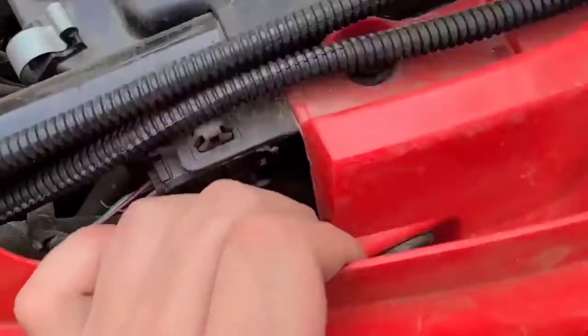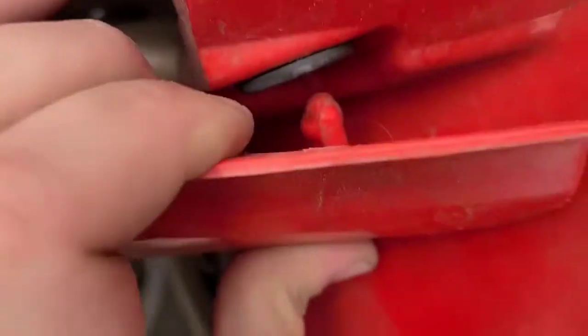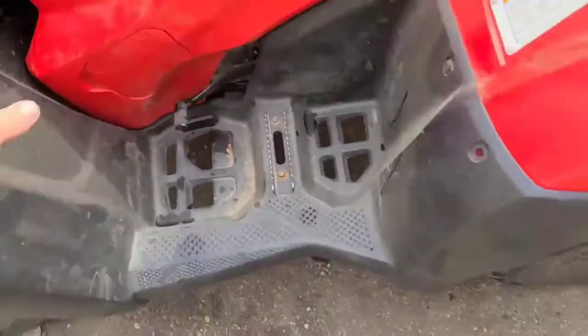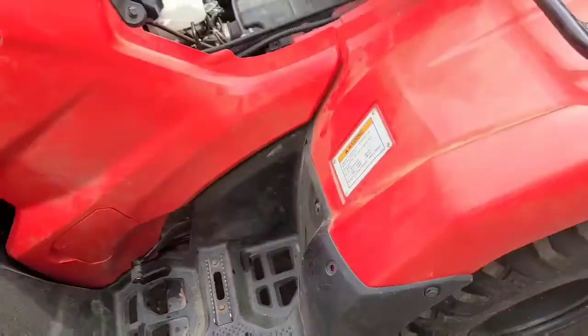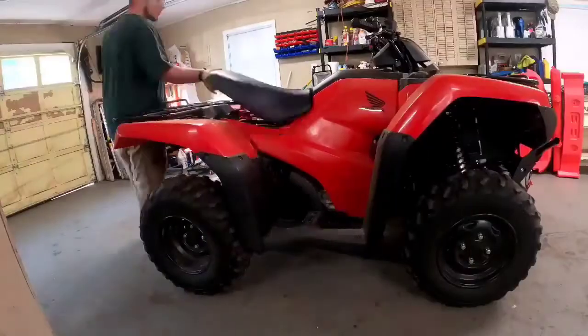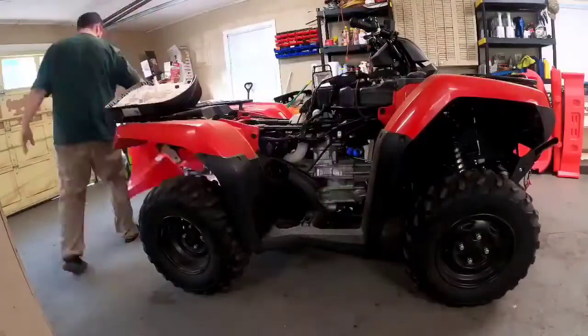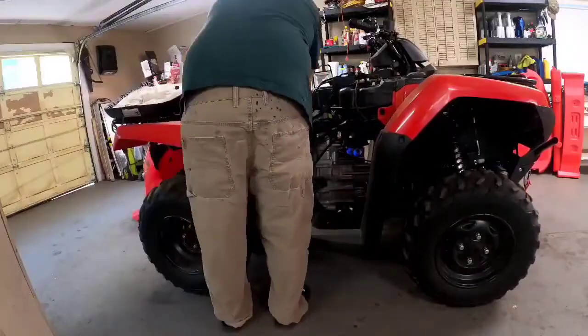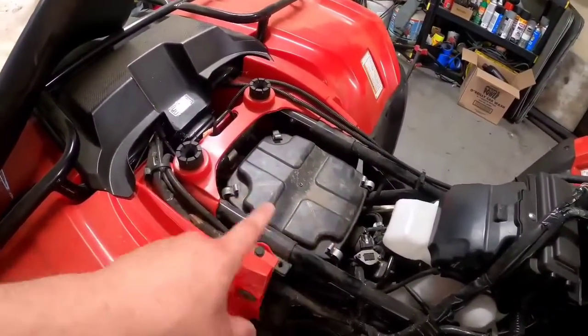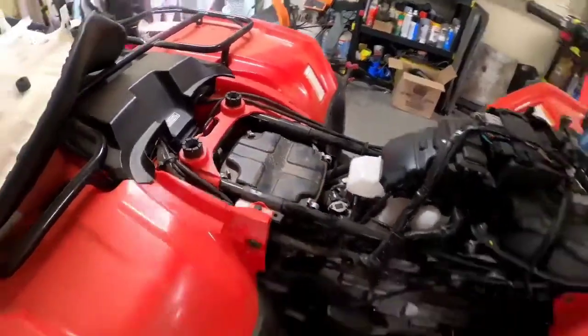The best thing to do is look down in here — these are just little plungers. Give them a little push and they will stick in. It seems weird; I was skeptical at first but it's been fantastic. When putting the fender back on, make sure all the holes are lined up before you give it the shove in. Then you can see me pop off this fender and check the air filter — you need to pop off these four points to check it, make sure it's clean, and put it back in.